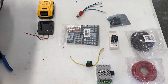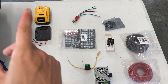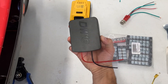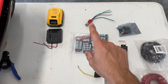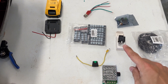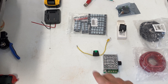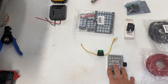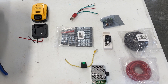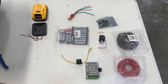So here's what we have. I purchased some extra stuff to go along with this to make the conversion and keep it nice and tidy. Up here at the top: the battery and the adapter to get the power out of the battery, a lit on-off switch, a low voltage cutoff, a 24 volt relay, terminal blocks to clean up the wiring, an inline 30 amp fuse, a voltage controller for the motors so we can vary that 20 volts between 0 and 20, and some power wire. That's an overview of everything we're going to use.